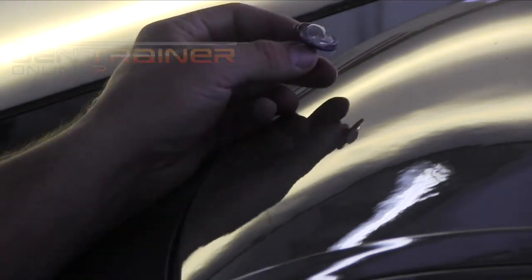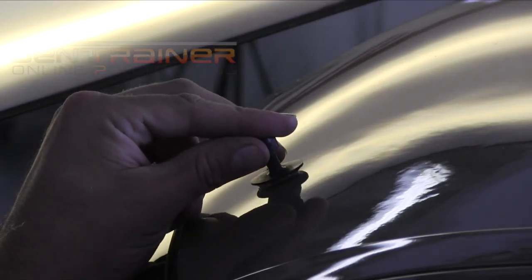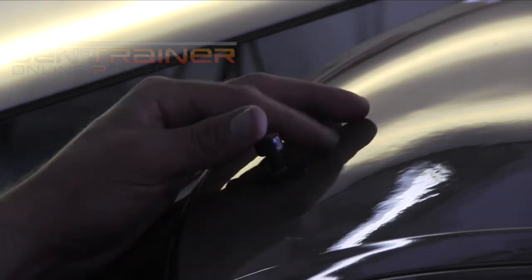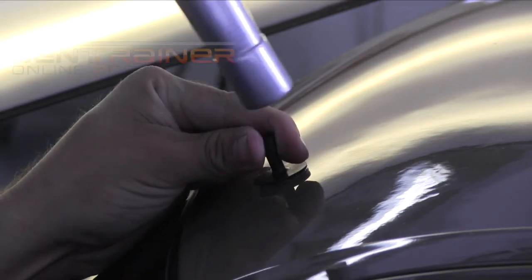I like to call this the glue pulling version of picking it clean. So we're looking for little dents. A lot of times a big dent like this is going to break up into a bunch of little smaller dents. The idea, however, is to make it to where the smaller dents are easy to glue pull. Sometimes it's overwhelming to look at a large dent and just see a kind of a big wobbly mess. However, you just got to stay focused, take your time, isolate areas, make your pulls, and little by little, you're going to see it shaping up.